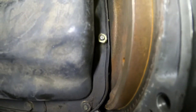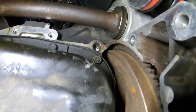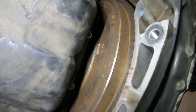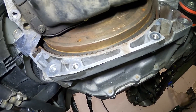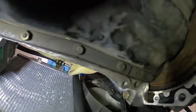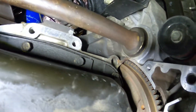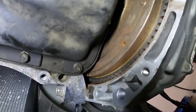With that plate removed, you can see that our 10 millimeter nuts have been exposed. There are both nuts and bolts on this oil pan, so just be aware of that. You can also see the flywheel exposed — that is an OEM flywheel by the way. I don't even know how many nuts and bolts are on this pan — quite a few — but I'm going to take my 10 millimeter and take all these off so we can drop this pan.